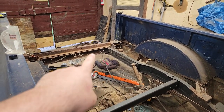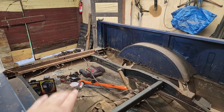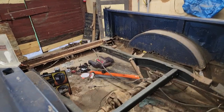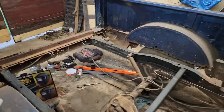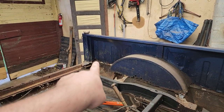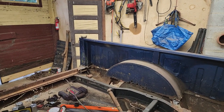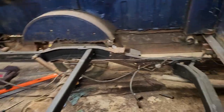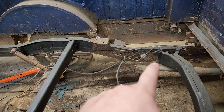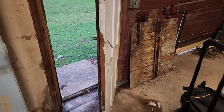I finished this section of the frame, so that's done. Another thing I need to finish before the bed floor goes in is this cross member — the swiss-cheese one — because the bed actually sits on top of it, so it needs to be replaced. I also need to fix and patch this bed support since the bed will sit on top of it too. Then I need to clean up the rusted corners and weld them back to that beam because they're a little wobbly. After all that I can put the bed floor in — the small patches should each take about 30 minutes.